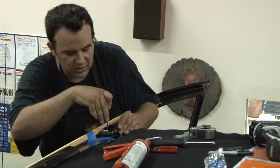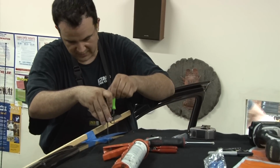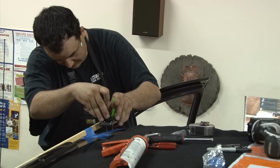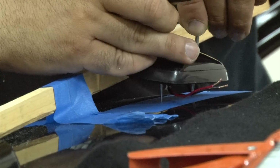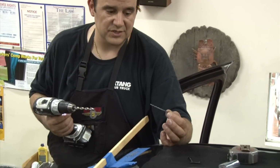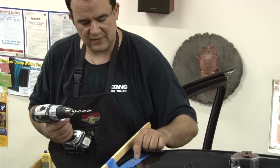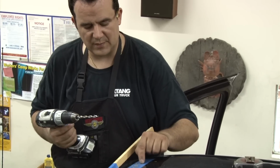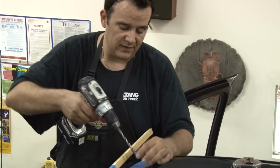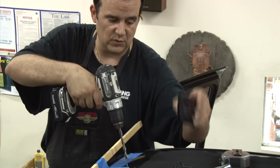You're going to come over and look at it and say, okay, that looks just about right. You grab your other pin, bring it down, and press it down. The 2 outsides are going to be the screw holes. That's a 1/8 inch drill bit. And then I'm using the 3rd hole on that 1/8 as well, but it's my pilot hole for my 3/8 drill bit, and that's going to be my center hole for the actual electrical connections.